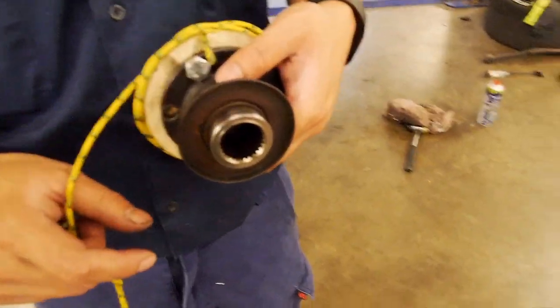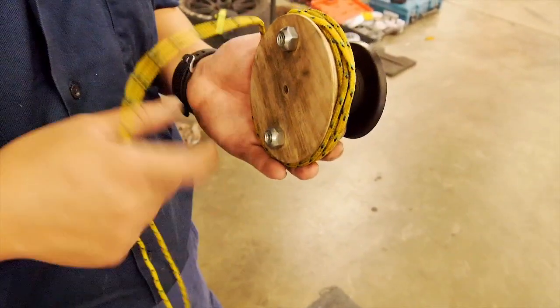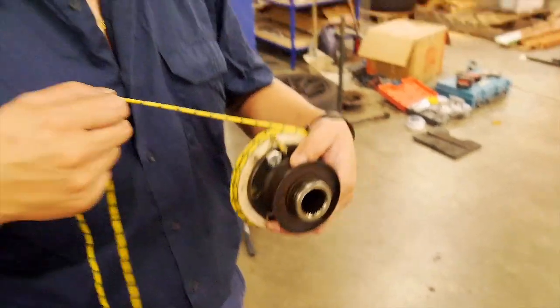You have a collapsible spacer in here, and the inner race of the bearing sits up against the collapsible spacer. On the backside you have a nut, and you do up the nut slowly bit by bit, and the preload will increase, therefore increasing the pull or the force needed to turn the pulley. So we'll sneak up on the right setting slowly. Before we do that though, we have to install the race in the housing, lubricate the seal and so on.